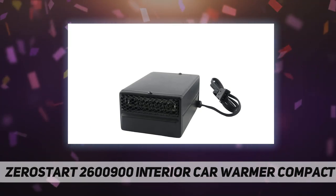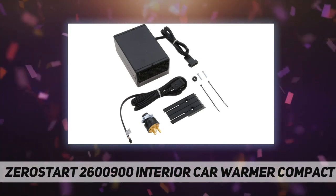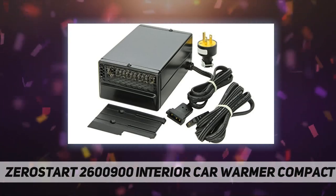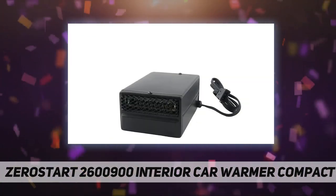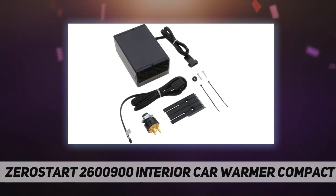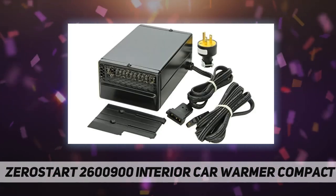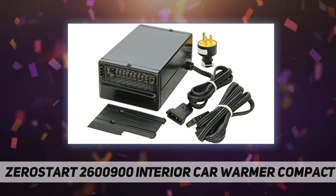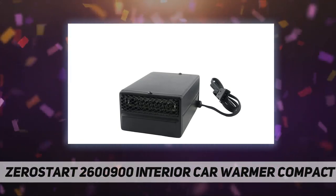Automatic high-temperature safety sensor — the device will automatically shut off if the operating temperature reaches 158°F. This sensor will automatically reset and resume heating after a 15 to 30 minute cool down. Secondary one-time-use thermal safety sensor automatically turns the heater off when extremely high temperatures occur at 286°F; heater will not turn back on and is no longer usable.